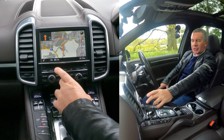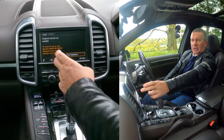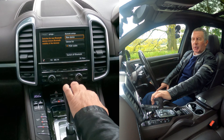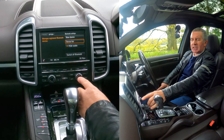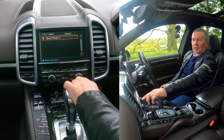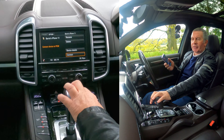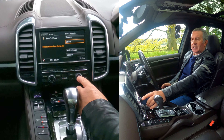We don't want a street number, so just turn down to 'Start Route Guidance' and click. It'll say 'Please follow the road' — and that's it. It'll tell you when to turn. You've also got the second clock from the right showing the route, so instead of looking down at the sat nav screen, you've got verbal instructions and a visual indicator right there.